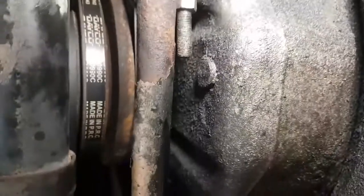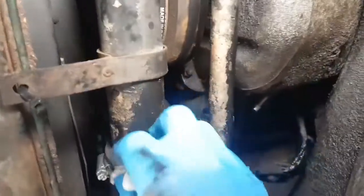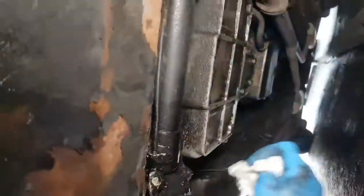Once I'm sure nothing's leaking, I'll be able to chemically clean the underneath of this car because it's completely filthy. I suspect it's never been cleaned in 36 years — it's almost definitely completely original. The hoses have been leaking and seeping oil everywhere. This is all transmission oil that's dropped out of that hose I changed last night. Soon enough I'll chemically clean underneath here, and eventually I'll get around to painting it all up, but those aren't exactly emergency jobs.